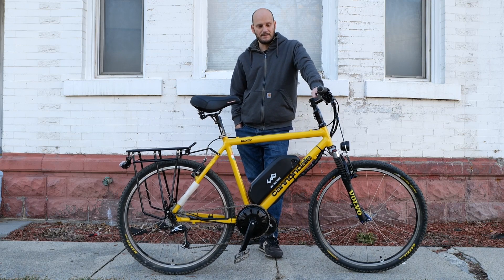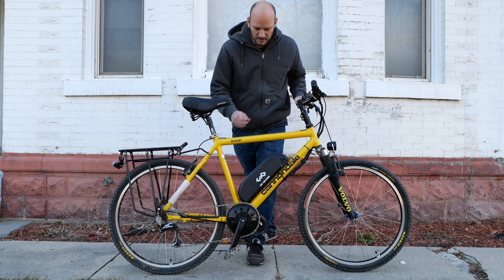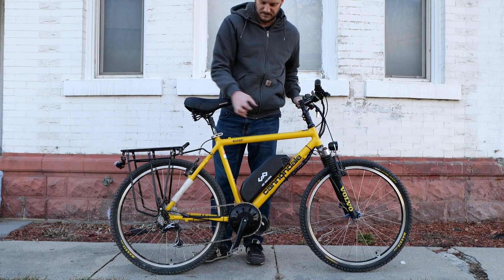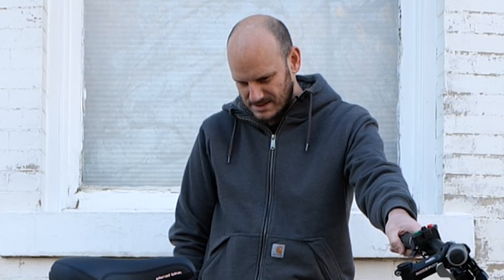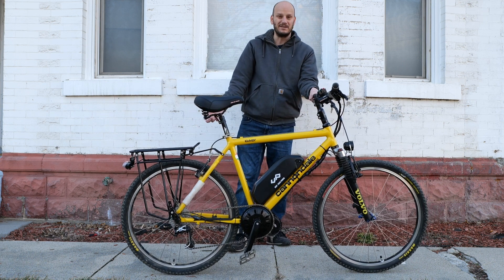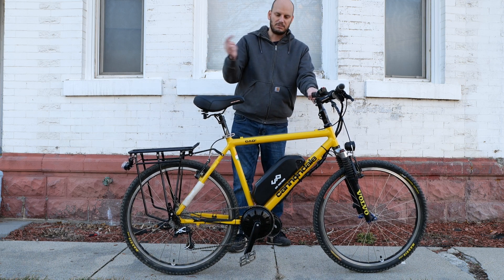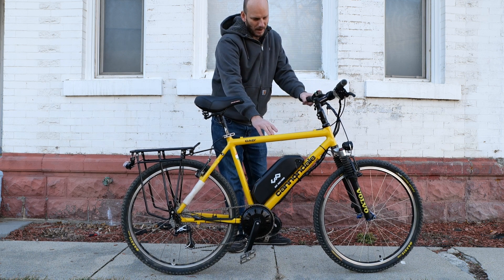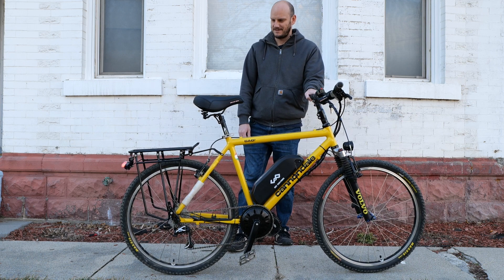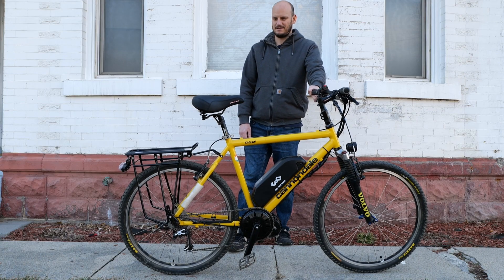You can see 33 miles an hour — not bad. It is really cold out here, so the battery is probably losing about 10% of its power. Hill climbing, no problem at all. This is a 46-tooth chainring and it's not a very big low gear, so if you swapped either for something closer to one-to-one, this thing would climb hills like crazy. Cost-wise, it's about $1,200 for the motor and battery. With all the extras here it's probably about $1,450 — and that's if you already have a bike, plus labor and shipping. Somebody shipped me this bike and I have to ship it back — shipping is probably about $130 to $150 each way, something to keep in mind. These brake lights — I really want to put them on every single bike I do now. They're so cool. Safety.